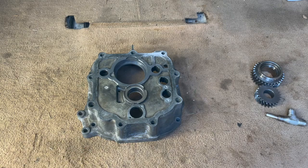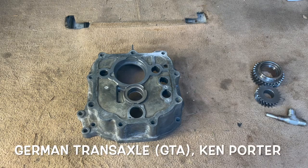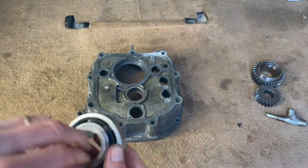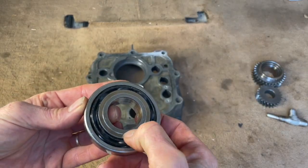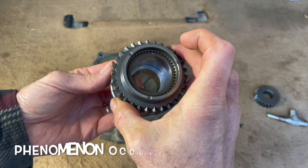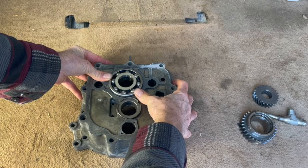I want to show some aspects of this gearbox that are the reason we want to cool it. I'm not a gearbox builder — I'm just an interested engineer, not an experienced builder. For real advice, ask Mr. Gas, Matt Seedle, Mike Herbert, GTA, Ken Porter — there are a whole bunch of experienced guys out there. But here's the main shaft bearing — it goes in the gear carrier — and this one here has wear on the thrust surface where fourth gear rubs on it, like a little orbital sander. The bearing goes in the bore right there — and watch, I can push it in by hand.